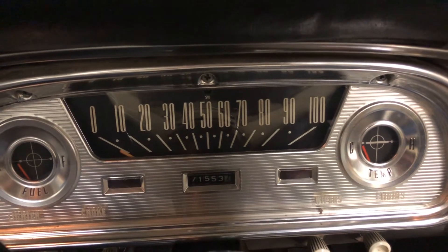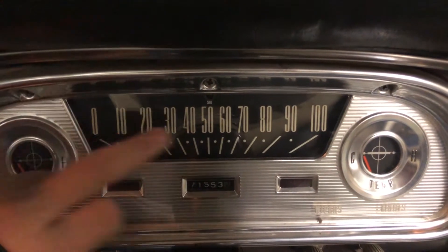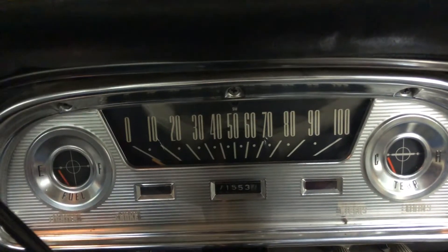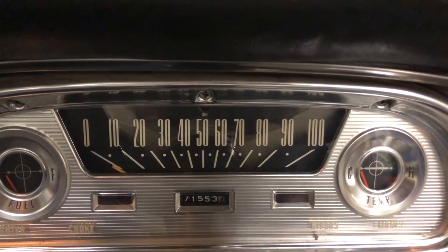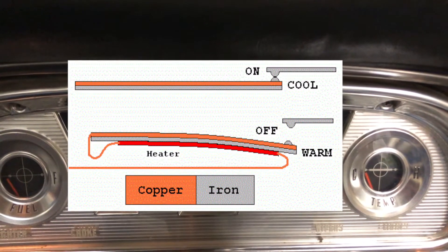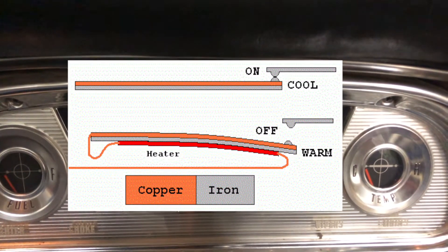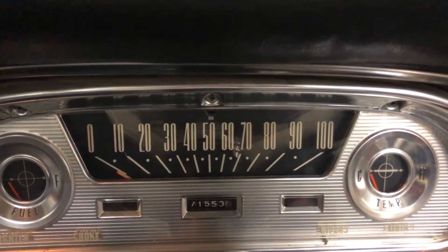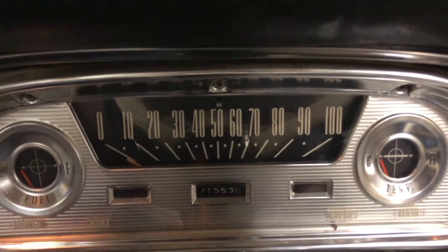The reason I am replacing — or I should say bypassing — the original voltage regulator for the instruments is that I have noticed that both my fuel gauge and my temperature gauge have been ticking when I've been driving. When I researched that, the reason is that these cars come with a voltage regulator from back in 1960 which is actually a bi-metallic strip, where one strip heats up, closes the contact, then cools and opens, flickering between 12 volts and zero volts to average out and produce five volts.